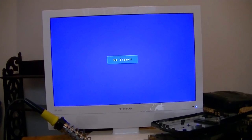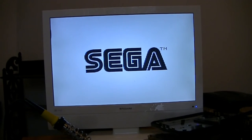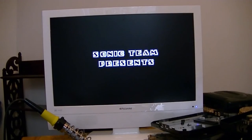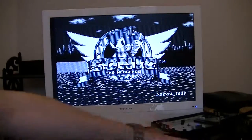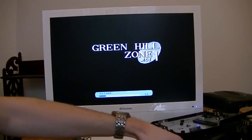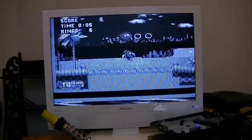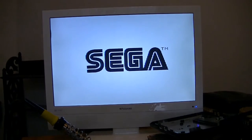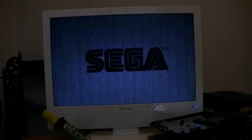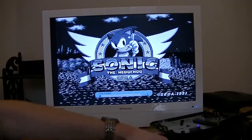Right, there we go — so it's now in 60 Hz. As I say, black and white on composite. So I just need to get an RGB SCART lead, plug it in the back of the telly and it will be a good one. Let me turn the sound up — and you can probably hear the difference between 50 Hz and 60 Hz. So that's 50 Hz — quite a bit slower, or faster depending on which way you look at it. It's not syncing up properly because I've changed it mid-game, but if you press the reset it syncs up properly. Quick as that. I'll come back in a few minutes and do the language mod for you — and that will be in another video.